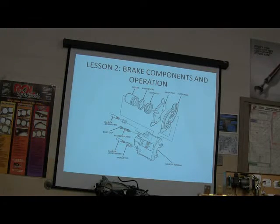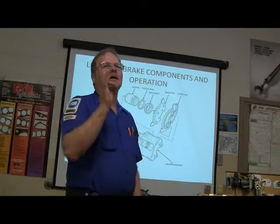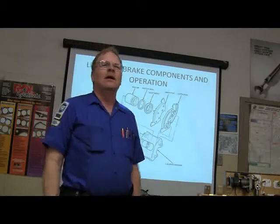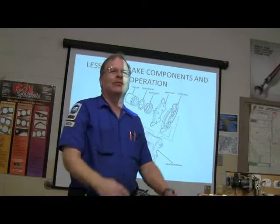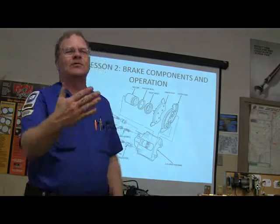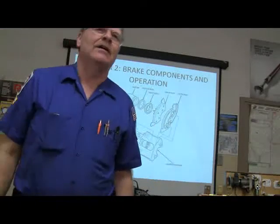You got me? So don't ever look at just one of the brake pads and say, oh, it's fine. I fell in that trap eons ago. I just glanced and could see with my flashlight that the outer pad was fine, but the inner one was worn almost completely out, and the guy that pulled the tires off and looked at it found something I had missed.